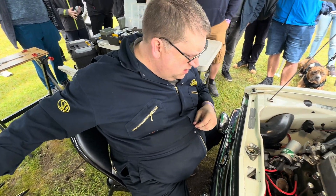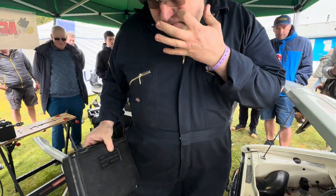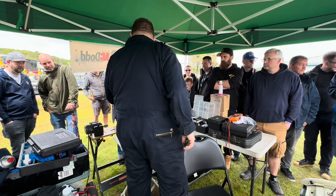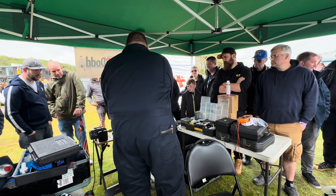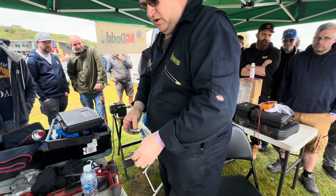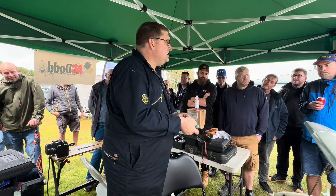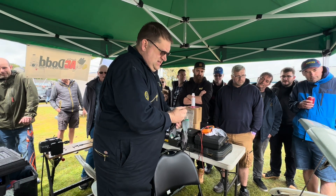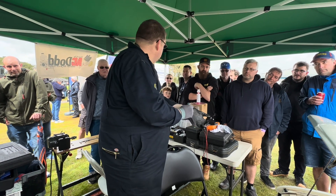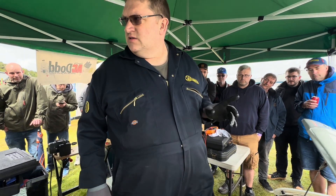I think I'm going to do a compression test. See those? Number four — brand new, but it's not good enough. That's worrying, isn't it? We've got three black ones and one with no colour on. So let's see what's going on with that cylinder. I suspect it may not have compression, because someone said earlier when I slowed it down it wasn't quite smooth — it was a little bit lumpy.